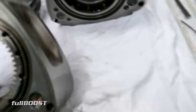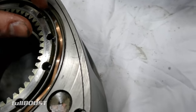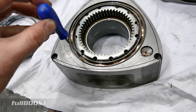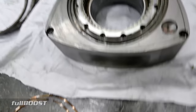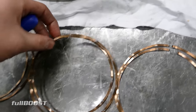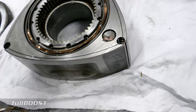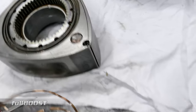There's a little divot right here. If you don't have any paint at all on the spring, it's pretty easy to find out what side these go in. If you drop that spring in there and try and drag it around — if you imagine the rotor is rotating this way, the seal is actually trying to pull it the other way, so it doesn't move in that groove. If I put the wrong seal in here, you see it spins — which means they won't seal properly. It's definitely no good, so definitely get that right.